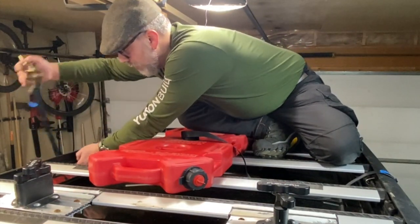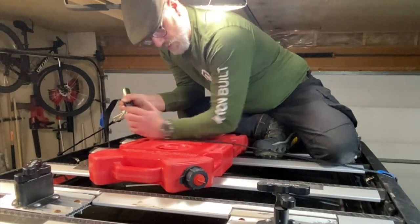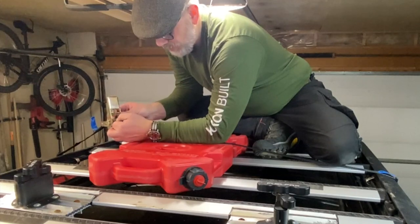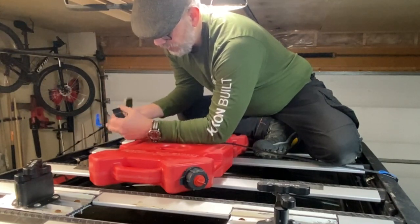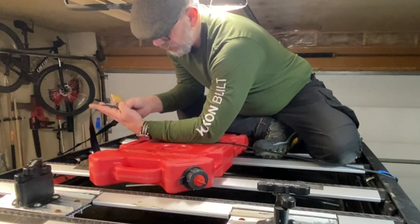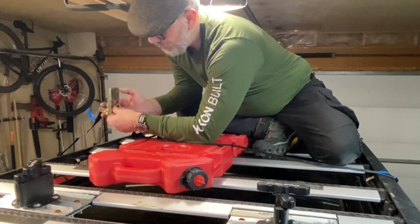Here's my ratchet, here's my uplock — open on the inside. We'll hook this round and then you have to try and hold this. I do it with my forearm, my elbow, whatever — hold it all together. The thing with the ratchet strap is to make sure that this bit, which is open, is in line with your tail. You have to move this lever like this until this is at right angles and then it's just open. Make sure this is flat — which is why I hold it with my elbow — and then run it through your fingers.